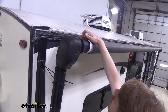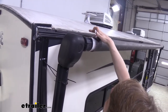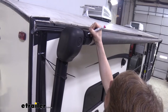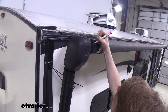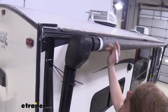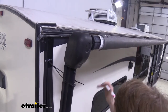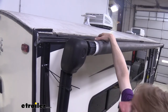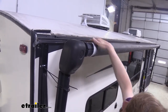I'm going to use a little paint stick and I just want to make sure that I've got it marked on each side so I know which way this is going to roll. Our fabric comes in on the top, so we're just going to put a down arrow on this side and on the other side, showing that the fabric goes down over the top of it. This will make it easier to ensure that when we're putting this back together, we've got it spooled up with the tension in the correct direction. We don't want this to be underslung either, because that could cause water to pool up and lead to water damage, stains, and mold.